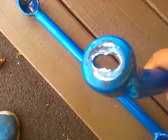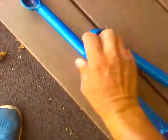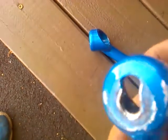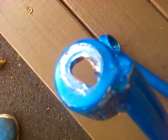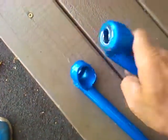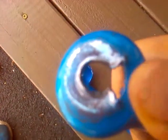What I'm showing you right now is that these poor things, made out of thin aluminum stock, tried to do their job but just were not up to the task. You can see that these mounting holes were originally circular, but just from the applied stresses of driving around — the frame twisting, going over rough roads, going through turns — these holes that were originally round became elongated.